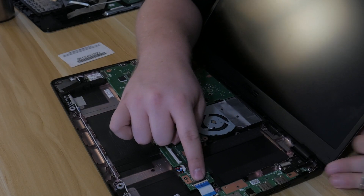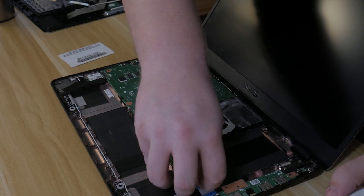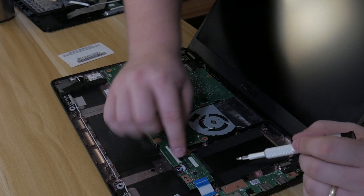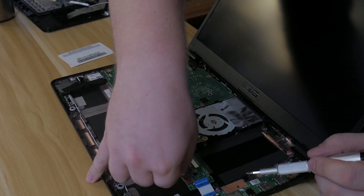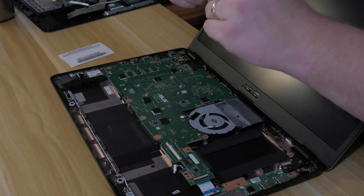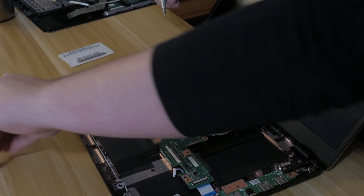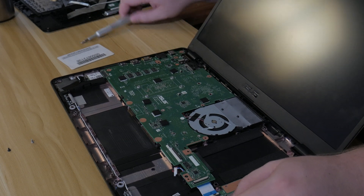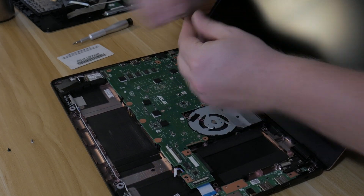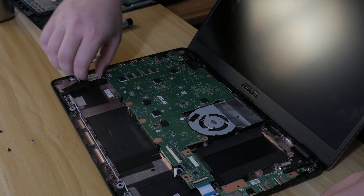There's a little ribbon connector right here for the daughter board for your I/O — SD card and things like that. What you do is flip up the white piece on this one and use the ribbon connector's blue grabber to pull out that cable. There is a small wire right there, so undo that connector. And don't forget your wireless card — undo the wireless card and you can leave the antennas where they are. All you have to do is slide back the actual wireless card so it is not connected in any way.